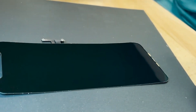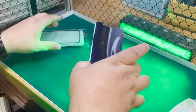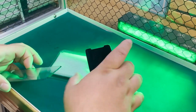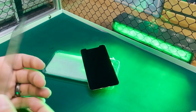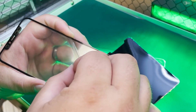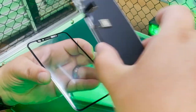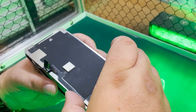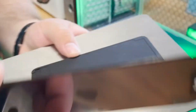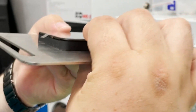When it comes to glass installations, there are different jigs that help align the display with the glass. For this model, I prefer to do it manually because the display likes to warp and bend — they tend to not sit quite nicely inside the molds. By doing it by eye, I'm able to get it lined up exactly where I want it. For the iPhone 12 and up, because the bezel can remain intact through this process, it's really easy to align the glass since you literally just line it up with the bezel.